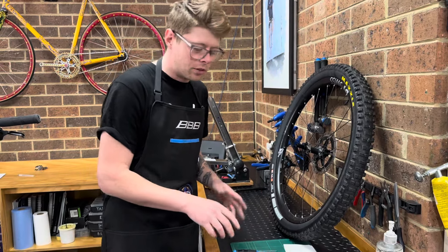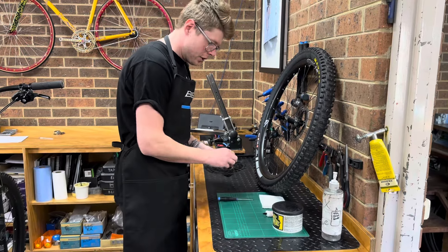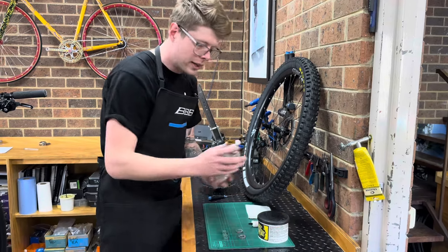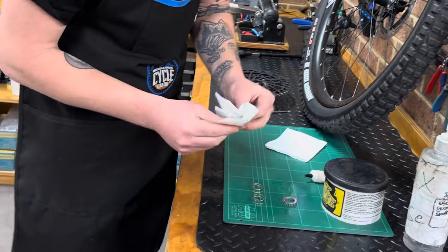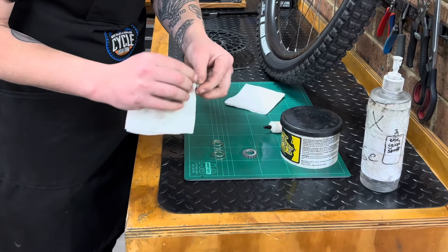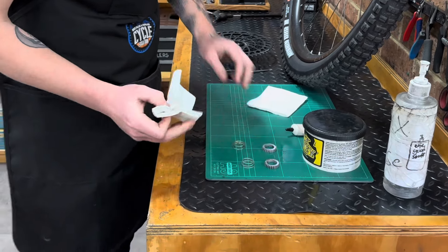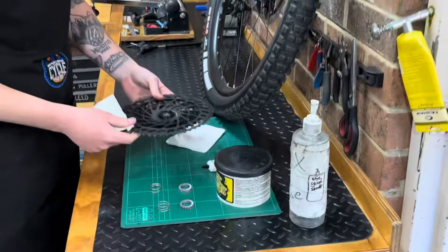Every time you service your bike you'll need to clean and lubricate the surface on these to ensure it's always running optimally. First, lay out all your parts nice and neatly. You'll need some sort of cleaner — a degreaser works fine. Give everything a really good clean up, making sure to get into the little grooves. Also clean the springs, and importantly clean out the spline surfaces in both the hub and the freehub body itself. Give those a really thorough clean and then move on to the next stage.